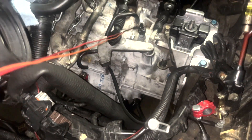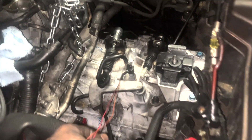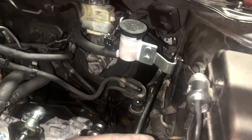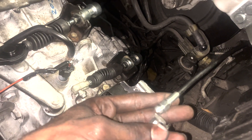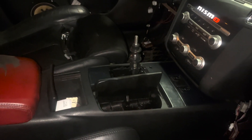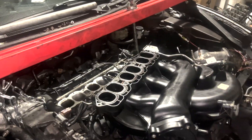What do I have left to do? I have two sensors — one down here and one up here — that need to be wired up. I'm not sure where those wires go yet and I'll check some forums for people who have swapped their Maximas. I also have to put my starter in and figure out the wiring for that. I have to connect my clutch fluid to the slave. I still have to put the subframe on. I haven't put on the exhaust portion yet because that goes on after the subframe. The shifter is good, getting into all gears. I still have to connect AC vents and stuff but I'm going to worry about that last and make sure everything up front is taken care of first.